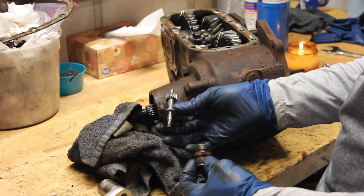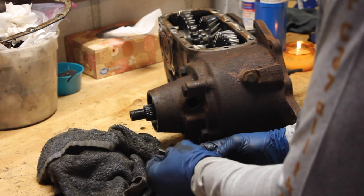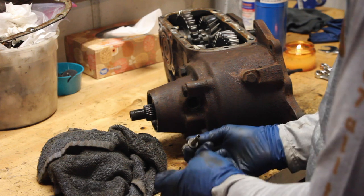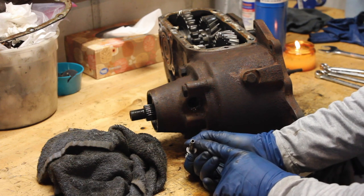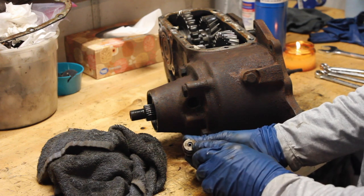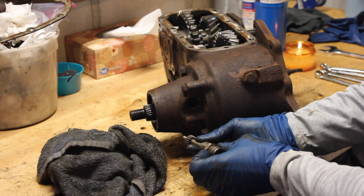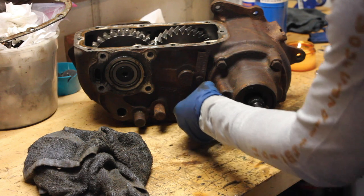Before moving on - this is the gear your speedometer cable inserts into. If you look at your speedometer cable, the shaft end is a square-pointed piece, and that square wire goes into here. Then it threads down on top of this housing, and the speedometer cable registers how fast this is spinning on the inside of the transfer case. These are 9/16 inch bolt heads.